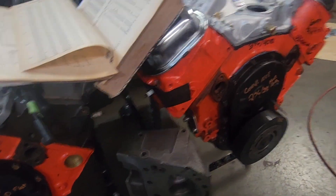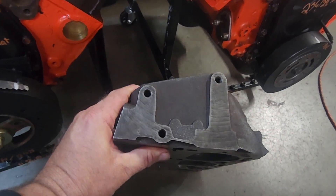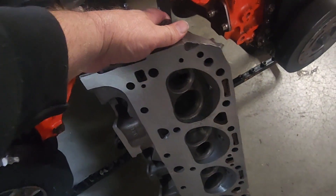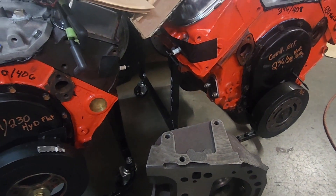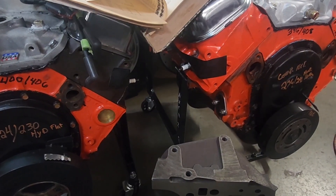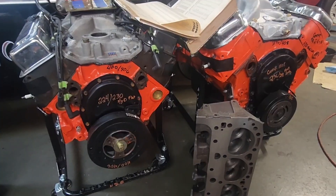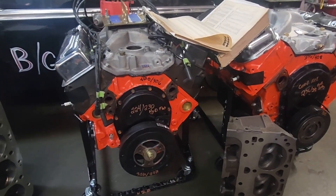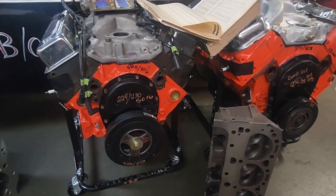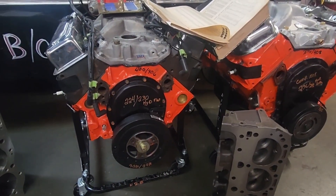To ease everybody who was concerned about me not getting the 406 small block to do much — I've got some classic 186 double hump heads. They're pocket ported and cut out to 202 valves. These are the same casting number they put on the Z28s and the 350-horse small blocks in 1969. I sent one head down to Eric Weingardner; he's doing some flow testing and is going to do a shootout between my 186s and some new Trick Flows I just bought. Then he'll ship them back and I'll get this thing on the dyno. I think we'll see a huge horsepower increase over the two-barrel heads with those 186 casting numbers. That's today's video — I appreciate you watching. This is Nick, thank you.